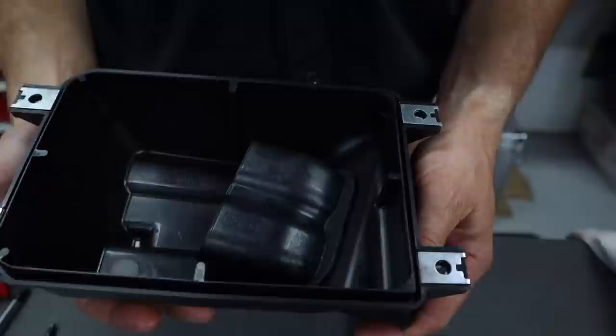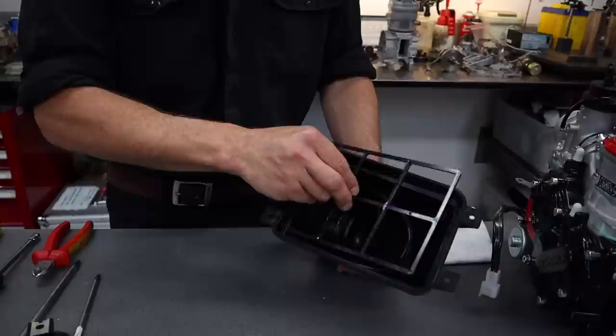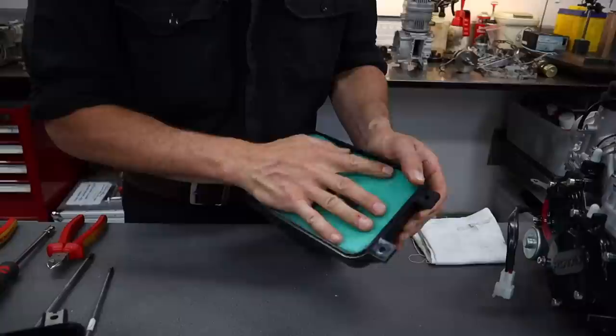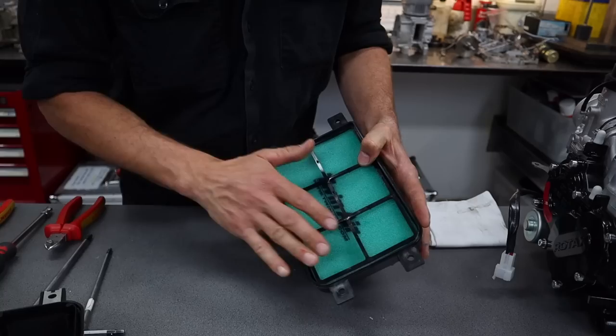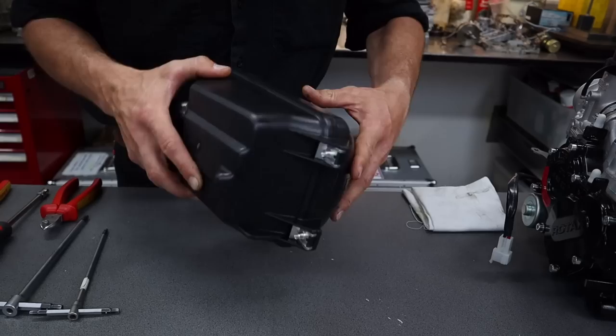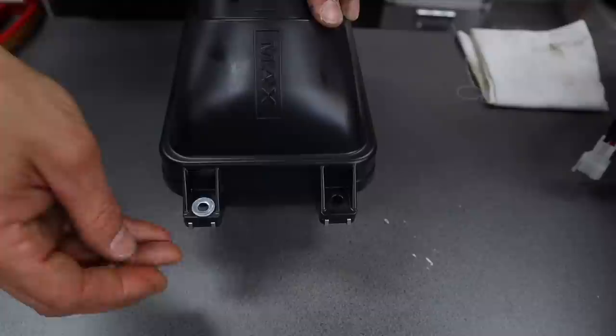Once the rubber lip flips over the edge you're good to go. Give it a little wiggle to make sure it's all home and it's ready for the air filter. The air filter screens go either side of the air filter and they are directional — they've got a slight taper to the top. Grab the screen and put it into the top of the air box. Take the air filter out of its plastic wrapping and slot it into the air box. Once you've got that in, it'll want to flop up but don't worry — it's only because it's new. Get the top screen and put that in, then the bottom of the air box goes on next. Just hold it there and slap the two together. Now we've just got to install the two screws and it's ready to install onto the engine.